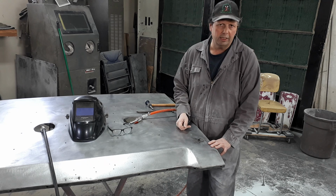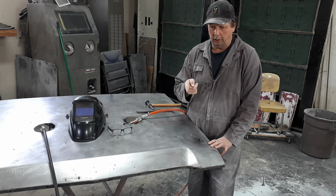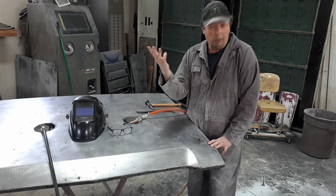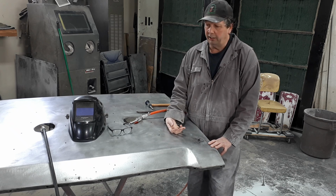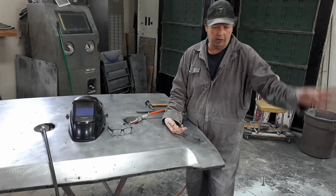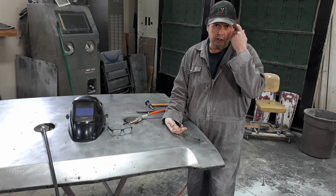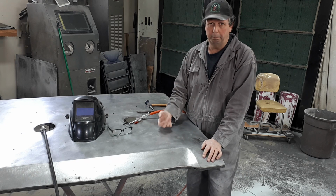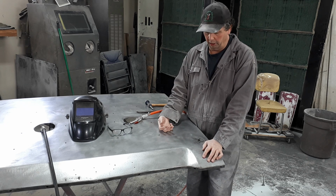How do you weld with less heat? Well, the easiest way, like my welder, that you can't see, but it's sitting right there, one is its lowest setting, and 90% of what I do, I weld on 1. If I get into some heavier interstructure frames, 2 is usually good enough for that. I've had the thing up to 4, but let me tell you, on 4, it peels the skin off your face. It's so hot.